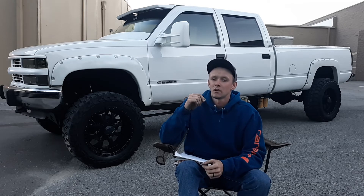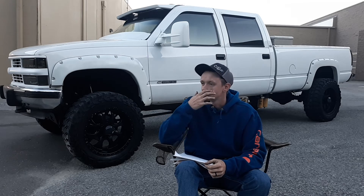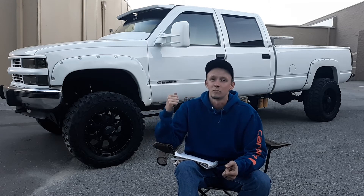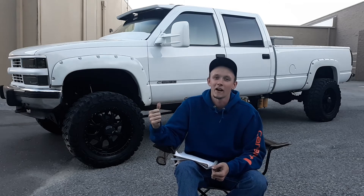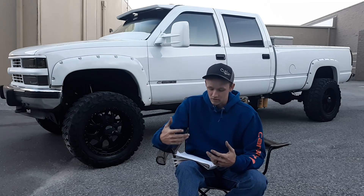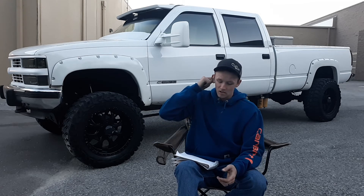Number three: rockers. I've only seen it a couple times personally, but your rockers for your valves can bend along with the push rods if you're really throwing the fuel to it and asking everything out of them. These are not brand new motors by any means — they've had a couple hundred thousand miles on them. Leroy Diesel sells aftermarket rockers for the valves on his website.